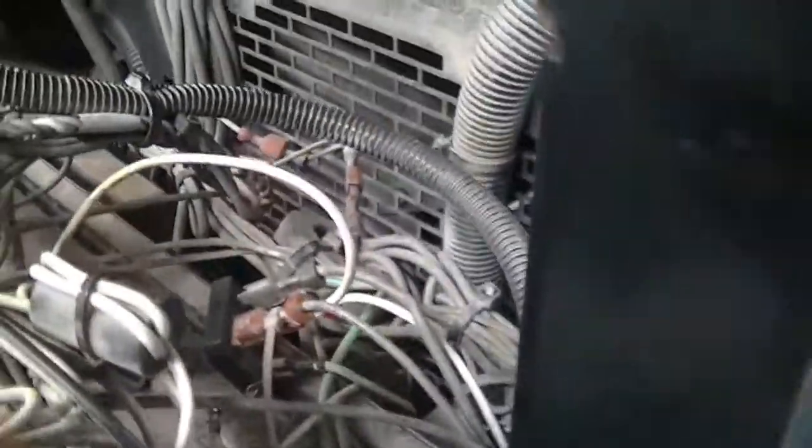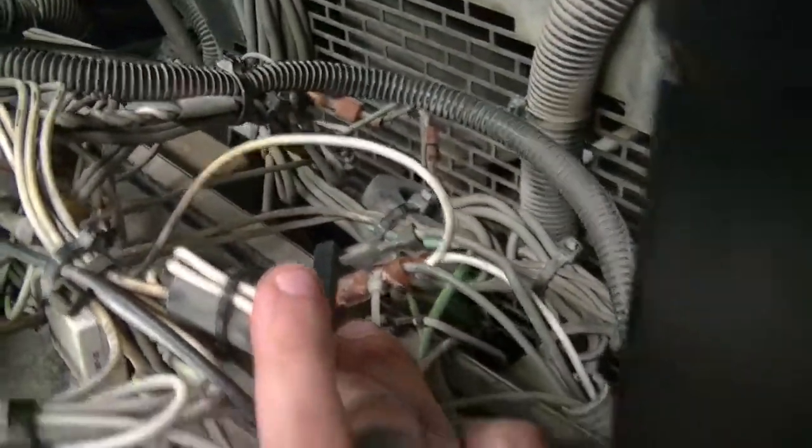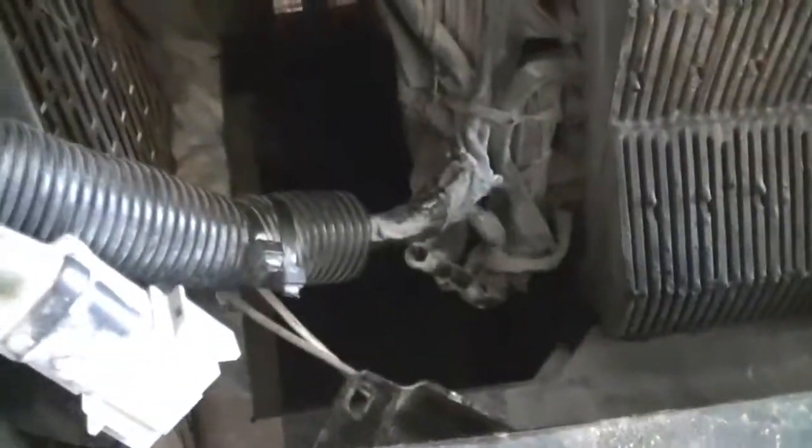So if you're getting power through your board to your bridge, your bridge rectifier is good. If you're getting 12 to 14 volts to your capacitor, that means you're getting flashing power to your rotor — that's all good, brushes look good. I'd go ahead and ohm out your rotor. These are known to go bad, and that's what happens to be the problem on this one also.